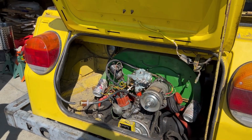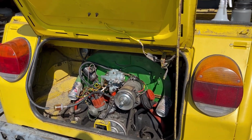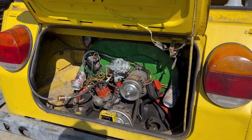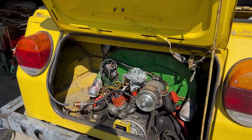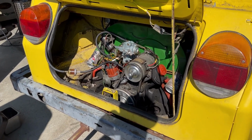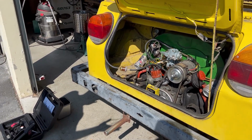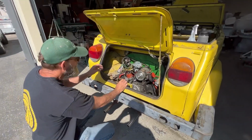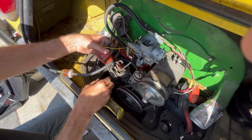So the dwell time is charging the coil to discharge into the spark plug. Not the discharge time. The discharge is instantaneous. I believe dwell's the close time. Now, how do you adjust that? It's the amount the points are open or closed. So the base setting for the points.